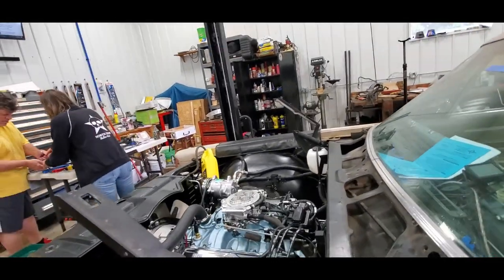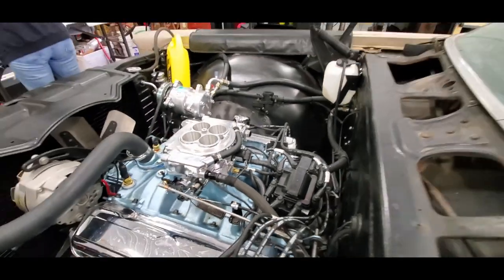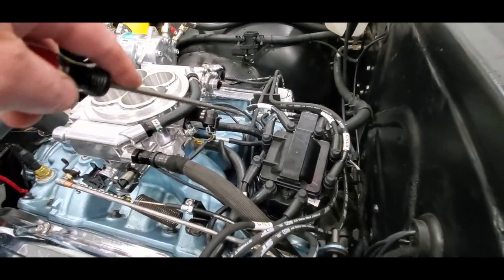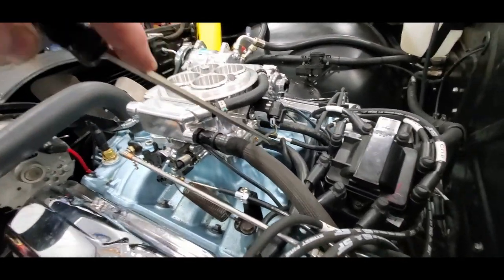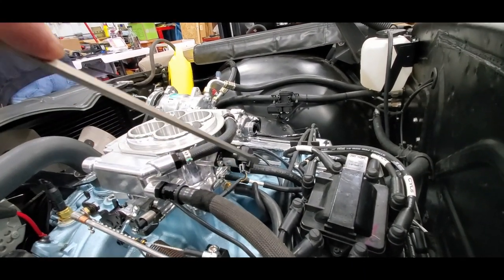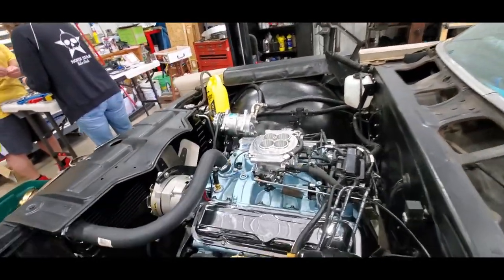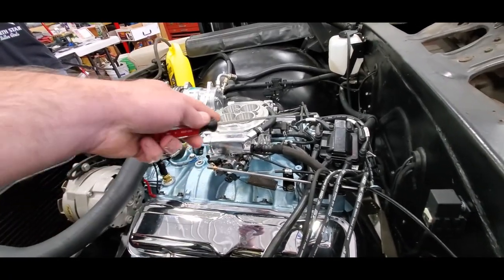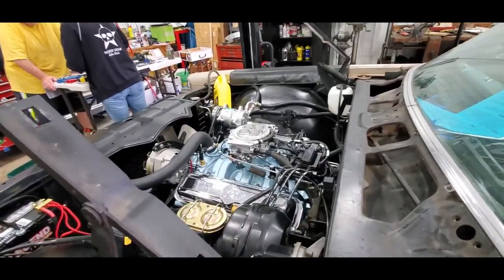The other big thing that we did is you'll see where number two's spark plug wire, which is this one right there, that used to run across right here, and there's a chance that that was one of our IAC issues, is that crossing, because these, you know, it's just some coils. So I've got it run low. Hopefully that's enough. I've seen reference of some people actually even using shielding, you know, aluminum foil or whatever, on those wires. So hopefully we don't have to get that drastic.